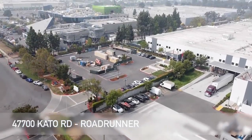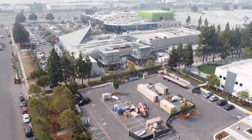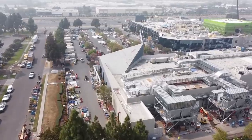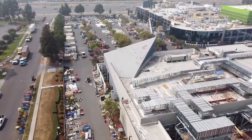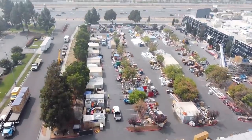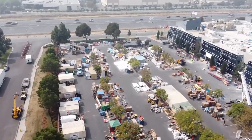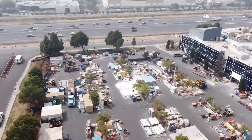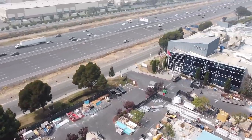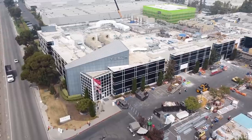In summary, Tesla's goal is to accelerate the world's transition to sustainable energy, which means accelerating manufacturing. A larger battery cell accelerates manufacturing and reduces costs, but competes with charge rate and energy density for the heat budget of the battery pack. Maxwell Dry Battery Electrode technology is the core solution — it reduces heat generated. A new thermal management system like plate cooling could further enable a larger cell. Finally, the tabless electrode is the icing on the cake, both reducing heat generated by a small amount and allowing plate cooling to work more effectively.